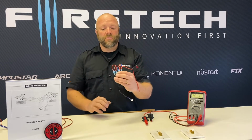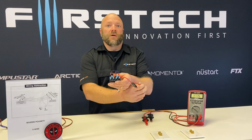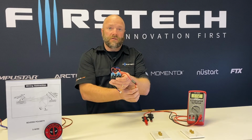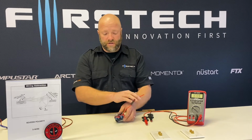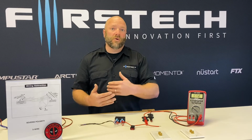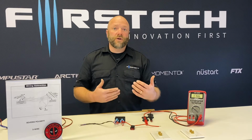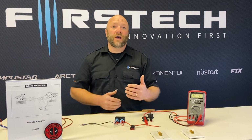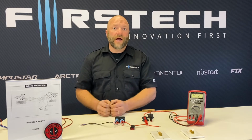And at this point, we have 2 pins left on each relay. Those are the pins that are going to get connected to the wire in the vehicle. So what you're going to do is find the door lock motor wire in the vehicle, and you're going to interrupt it. To test for that door lock motor wire in the vehicle, before you cut it, to verify that circuit, you're going to test that that wire rests at ground. So it should show ground at rest.